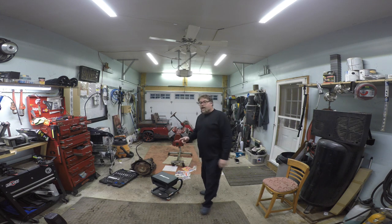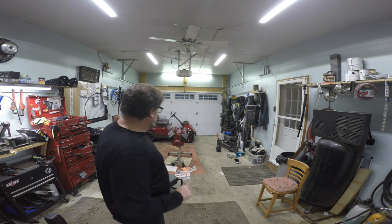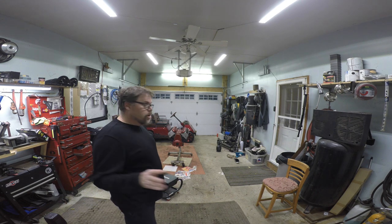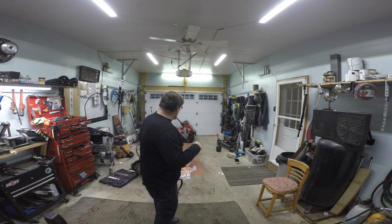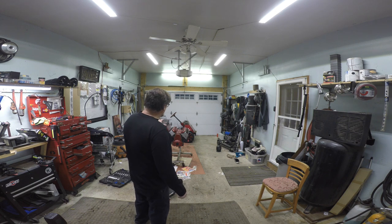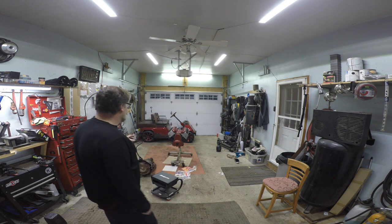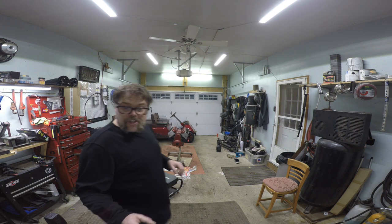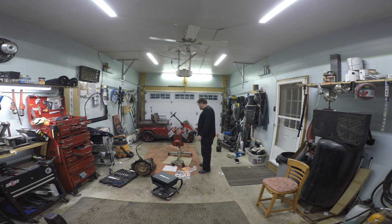Subscribe, like, hit the notification bell button too. This weekend what I'm planning on doing is sticking the heads back on, getting some play-doh in there, snugging it down, doing the play-doh test just to make sure it works with the smaller head gasket, and then we're going to button the heads up. The rockers need to be tightened up. We're going to get that done, buttoned up, and then we can roll her over and put the oil pan back on. It's been about a week, so let's get some oil into this thing — just a little bit, just to keep it lubed.